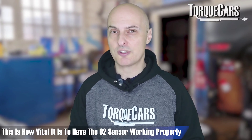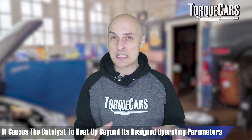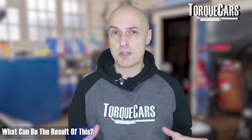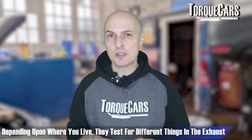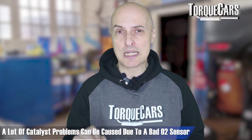Nearly two-thirds of vehicles that failed to meet emissions regulations needed an O2 sensor — nothing more serious than just a bad O2 sensor. The engine may be forced to run rich, and the problem with a modern catalyst running rich is that unburned fuel enters the catalyst, causing it to heat up far beyond its designed operating parameters. This can melt the catalyst structure, degrade its performance, or cause soot to build up on the catalyst surface, shooting emissions levels up.